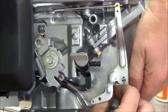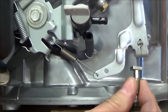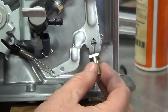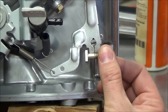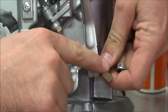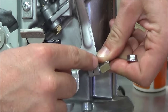Let's take this apart and look at it in the video. As we talked about in class, that's the shouldered bolt — see that big edge. What I don't want to do is set this on edge top to bottom. Its design is to be lengthwise — to have it the whole width — so that we're contacted all the way across the top of the bolt instead of just on a short edge.